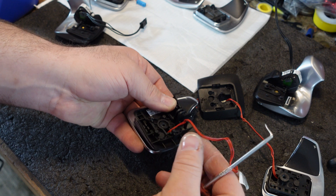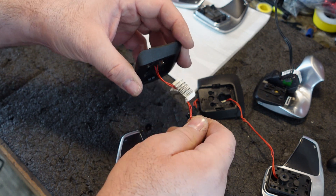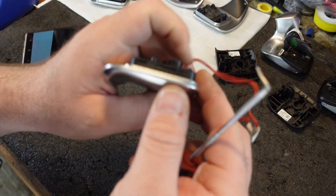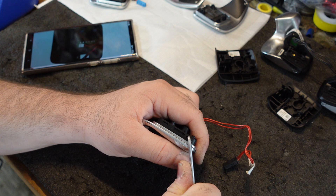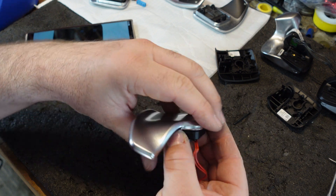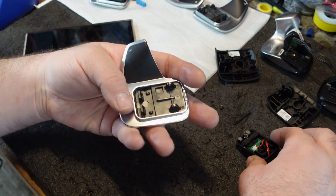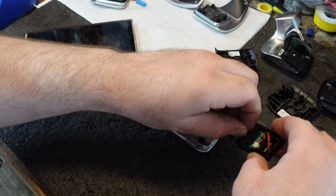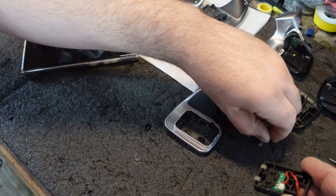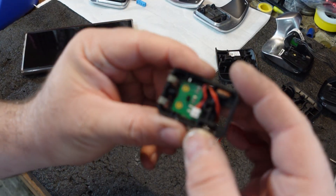Pick the harness out and around through these little tabs here, and once you end up pulling the base plate off just put it aside because you don't want to lose these. From here there's going to be a plastic pin connecting the two together — there's a large side and a small side, so just take a pick, push on the small side, and pick it out through. When you take it apart be a little careful because there is a spring and some plastic items that you do not want to break, because you cannot find these in another paddle or purchase them through BMW. Also keep in mind this little rubber piece — some of them have metal portions inside and some don't. Here, as the camera eventually focuses, are the resistors that we need to deal with.